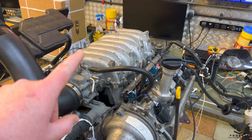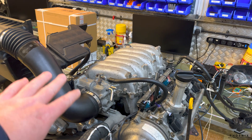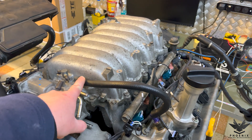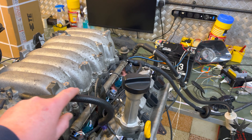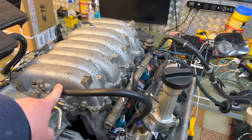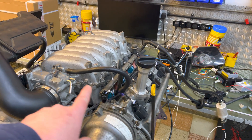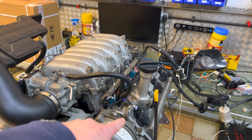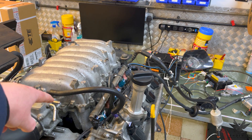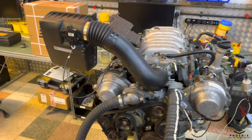The issue is in relation to the air pipes — because you guys doing a lot of swaps don't always use the original air pipe, sometimes due to space constraints. The PCV system: you'll notice there's a pipe going from here to your PCV valve over there. Normally it's shorter and has a piece of foam over it. I see a lot of photos where you guys are leaving this in place, which is absolutely fine because it is going into the inlet manifold — drawing air from the engine into the inlet manifold. This also explains why, if you pull your cam covers off, one side is so dirty and the other side is so clean. Air comes in there and gets sucked out into the inlet manifold. It also explains why, when you open up the inlet manifold or take the throttle bodies off, you see a little puddle of oil in there — that is coming from there. So this being connected is absolutely fine; the problem comes when the other side is not connected correctly.